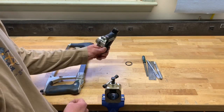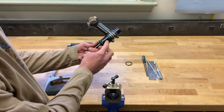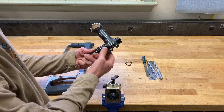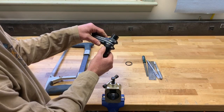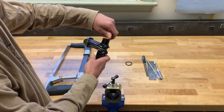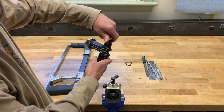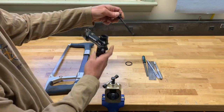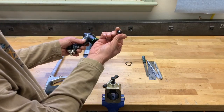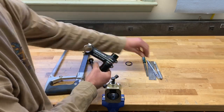Here I have the upper portion removed from the bike. I've got my two spacers installed and my stem pushed down tight on the spacers. First step before I forget, I'm going to remove the top cap portion. This way when I go to cut the steer tube I'm not sawing through the long stud that goes down into the wedge at the bottom.